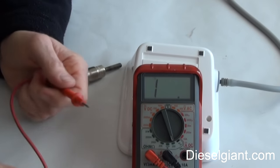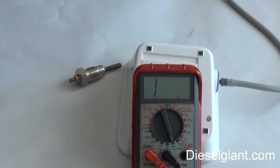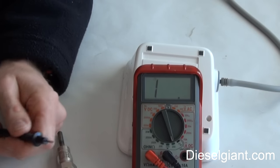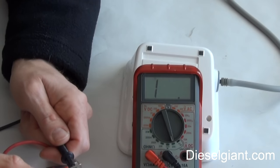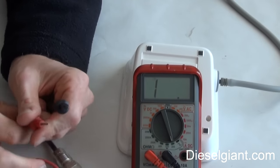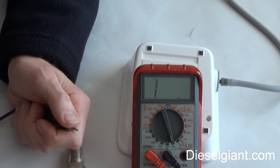Just make sure — don't test a battery when on the ohms setting. It has energy, and as soon as you put the probes on either side, it could blow the fuse. When it's in the ohms setting, you're testing resistance. You can test bulbs, wires, from one end to the other. If it shows open, that means the wire has a break in it. If it reads about 0.4 ohms, we know the path is complete and not broken.